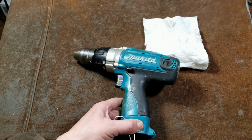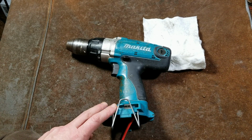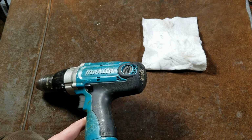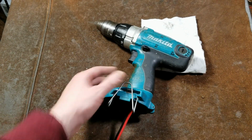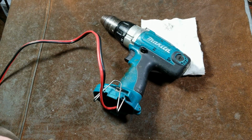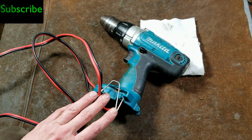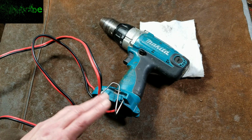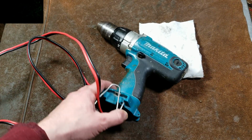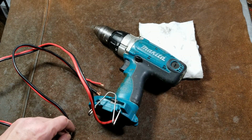Because it shows really that these drills did have some pretty darn stout motors in them. Probably too stout because of the number of brushes that had overheated. But man, these were awesome. And I would have liked to get a nice demonstration, but I guess I didn't really anticipate needing a 50 amp 14.4 volt power supply to properly drive this. 40 or 50 amps easy, because it was just quickly and very easily overloading 30 amps worth of power.